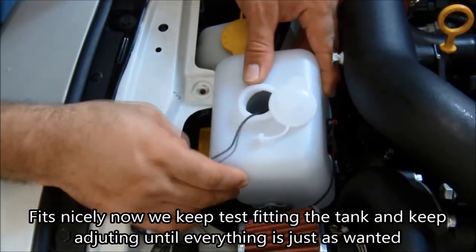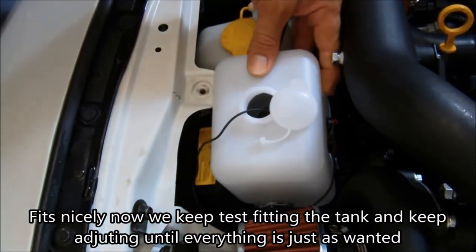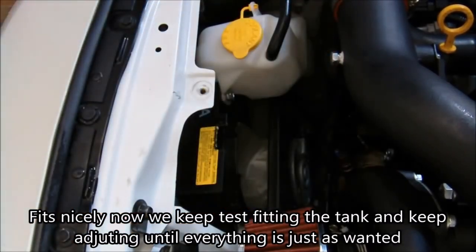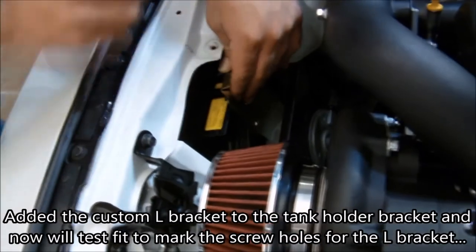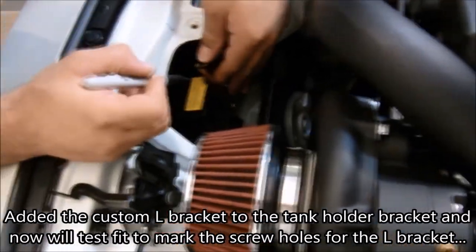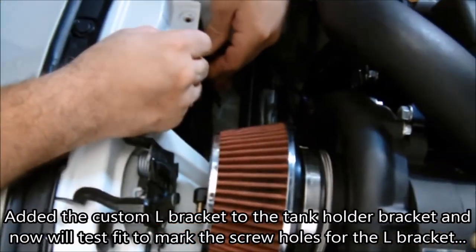As I said, you could use a sensor that turns on with RPM or with boost — I think that's the best way to go. The boost switches are actually fairly cheap on eBay. If you search for 'adjustable boost switch' on eBay you'll find a few different options that can help you with this or similar setups.